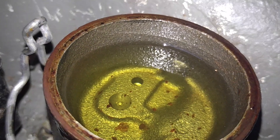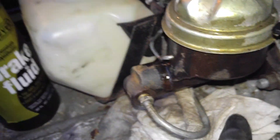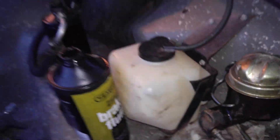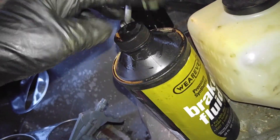Then you go out front and make sure you have fluid in your reservoir, because twice I was doing this and removed the cap and the fluid was right down. I forgot to cap the bottle. I wonder if this new synthetic stuff is hygroscopic and absorbs moisture from the air. Here's my rebuilt master cylinder that I rebuilt myself. I put the old seal back and it was leaking, so I put the new seal in — cheapskate that I am. Let's see if I've stopped that leak in the back. What happened was it was leaking internally into the car and staining my nice new carpets.